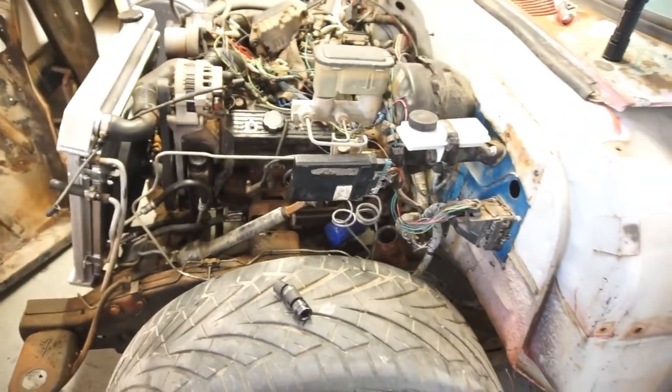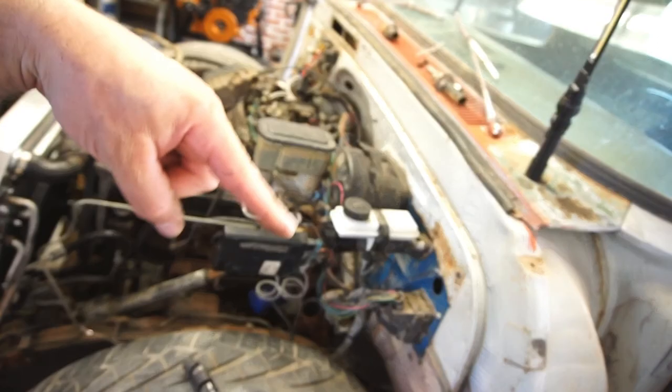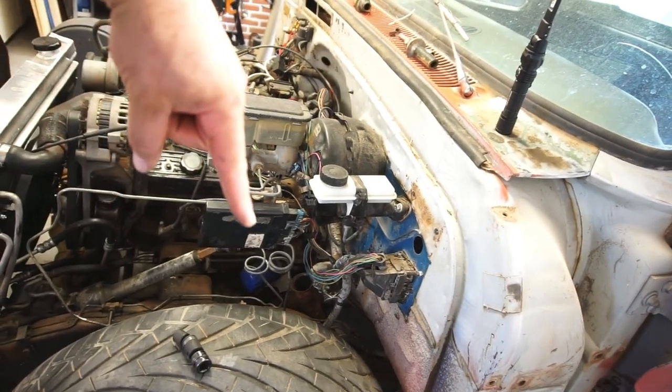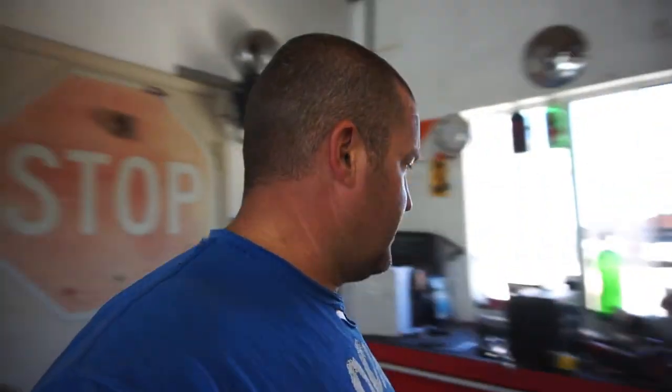So, anywho, let me go. There's a better look down in there. So I'm going to go ahead and take off the other side. I think the other side's going to be a lot easier. I'll do that off camera. The only difference is I'm going to unbolt the collector down there first, because the exhaust manifold went like this and the bolt was up against the pipe. So if I leave it in, I'll be able to undo it. So I'm going to undo it like that this time. I'm going to zip it off real quick. Then I'm going to go eat some lunch, or actually some breakfast, because it's only 10 o'clock. So yeah, this is just the video of unbolting the exhaust manifold. Same words, different way.